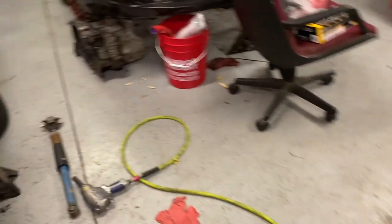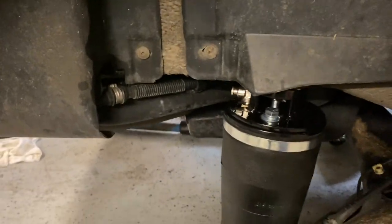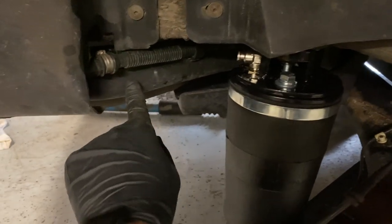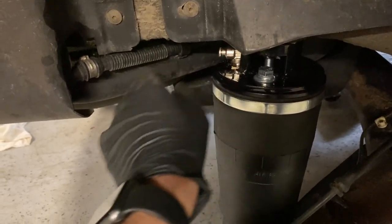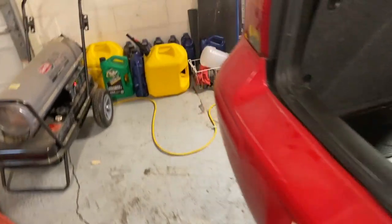Yep. So, rear bags are in, kind of. So, this side, we got away with a little bit of a cheat. The fitting running off the back here can actually follow some other line, I think it's all fuel stuff, emissions probably. But long story short, we can use it as an anchor, no friction points, and it gives us a nice little spot underneath the bottom there to go straight into the cabin of the vehicle. Driver's side's not as friendly.